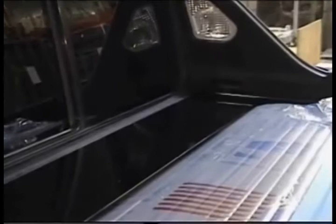Final positioning of the bed cover is best done from inside the bed. Lift the canister slightly and push towards the front wall. Be sure the front cover weather strip is level and in position across the front wall of the bed.